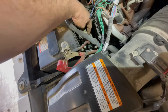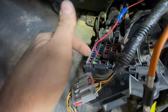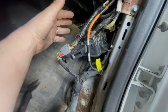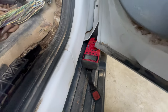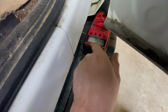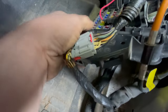I looked up the wiring schematics and found that cable goes to the BCM, which on this vehicle is located on the passenger side. The body control module has a bunch of fuses attached to it. An aftermarket splitter initially caught my attention, but that turned out not to be our source of parasitic drain. I started pulling fuses one at a time while monitoring the parasitic drain — it's showing 160 milliamps right now because I recently plugged a few things back in and some modules still need to go to sleep. Ford says it can take up to 40 minutes for all modules to sleep.